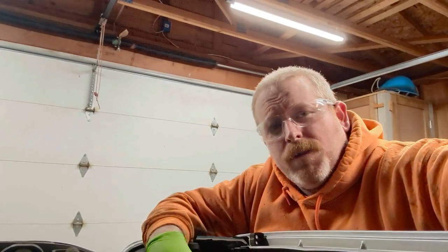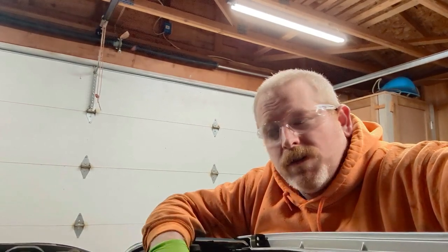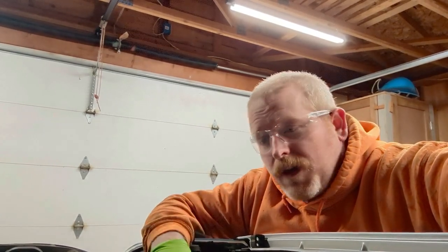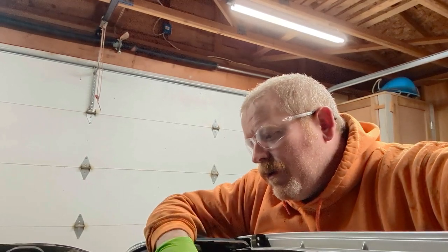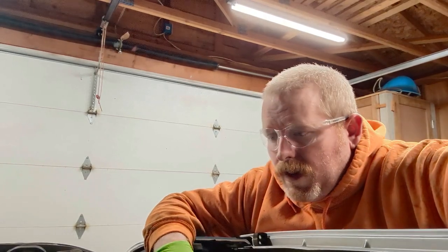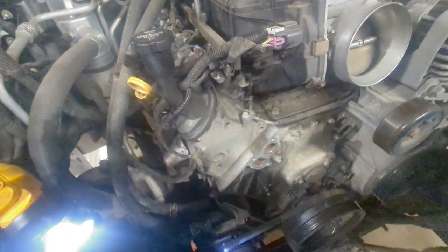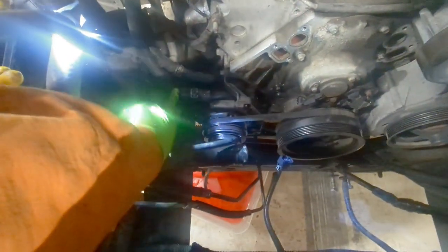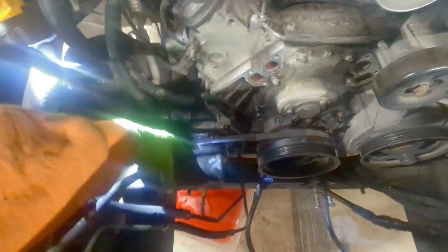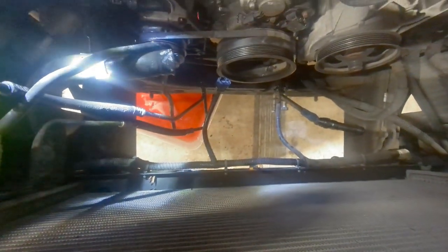That was all we needed to do on the bottom side of the motor for now. Next, take off the serpentine belt, cooling hoses — you'll drip some antifreeze so have paper towel on hand — then remove the crank pulley and water pump so we can get behind to the timing cover. I've gone ahead and taken off the water pump. These two hoses go to your heater core, there's your lower radiator hose, and the big one is your upper radiator hose. I also removed the cooling fans just to make a little more room.